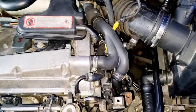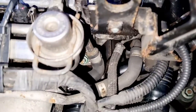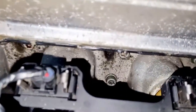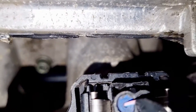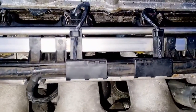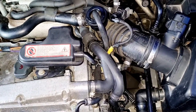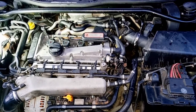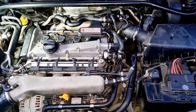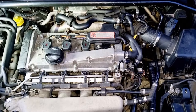We are all connected back. The top pipe joins this pipe that runs down to the components underneath — you can maybe just make it out there, though the light isn't great. Everything went back nice and easy, so just the covers to replace now, and a few more checks to make sure everything is tight and locked in. That is how you replace a positive crankcase ventilation system on an Audi TT Mark 1. Once we get all those bits back in, I'll give the engine a fire up — and hopefully that will have solved my rich running. Fingers crossed.